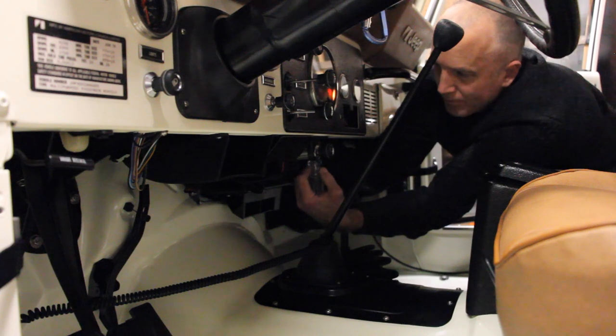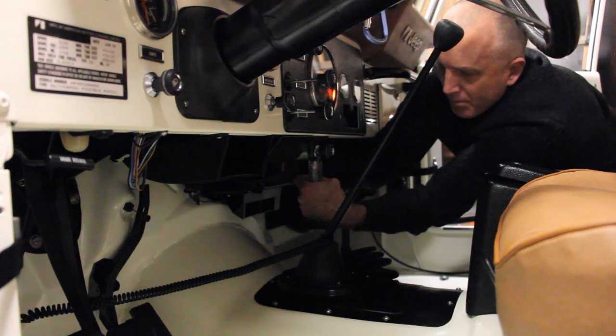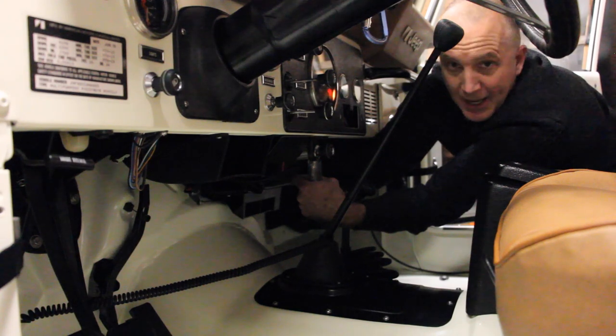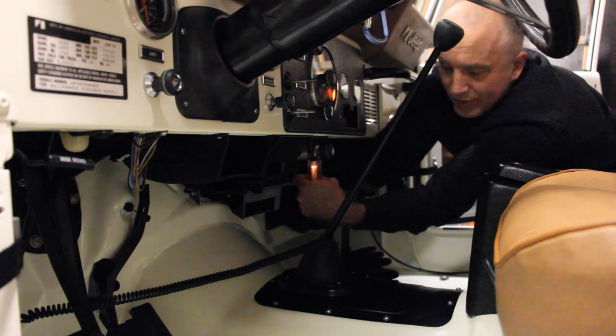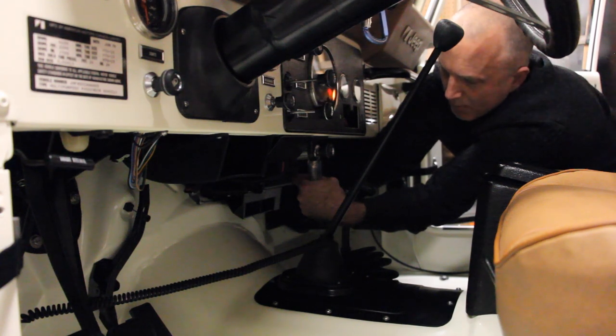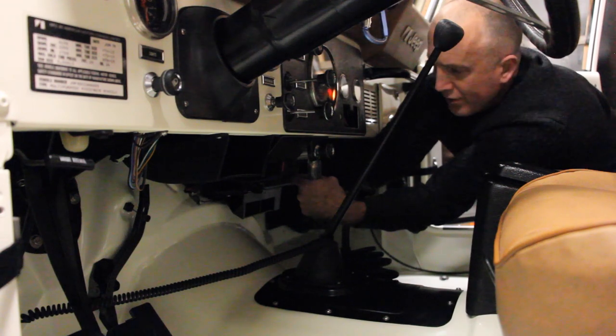Hopefully that doesn't happen to you. If you go to the sending unit post and get that connected, it should flash but be significantly dimmer. The more full the tank is, the dimmer the light gets. If it's as bright as the A post, then you probably have a problem with your sending unit. As for right now, it's flashing but really quick and dim. My guess is that the sending unit is bad in this CJ. We'll see — just keep testing.